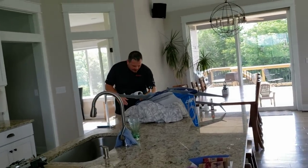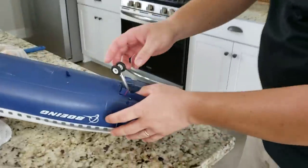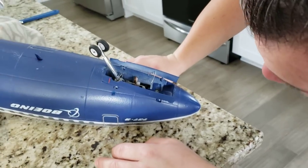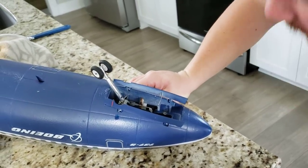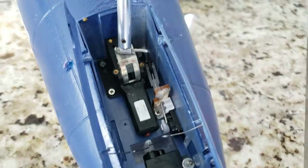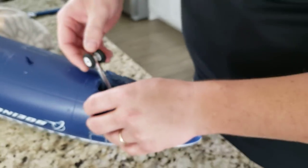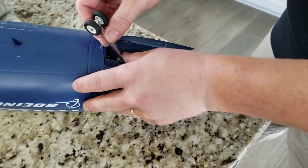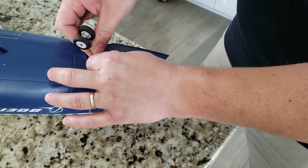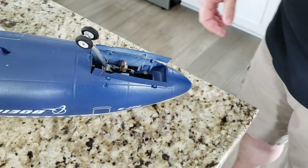So there's a couple of different trains of thought on straightening stuff like this. My hope is I can just bend it, and if it breaks, then I'll have to get more aggressive with it. Show them that. See this? You can see that flat spot. There's a weak point on these landing gear where the piece bites down on it, but it's pretty soft metal. If it bent back, it'll bend forward. It's just probably not going to bend forward very nice. It's a little bit scary.